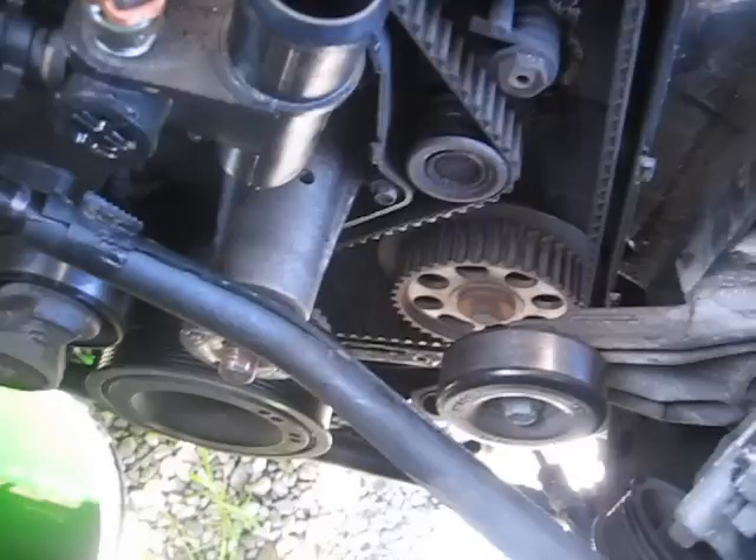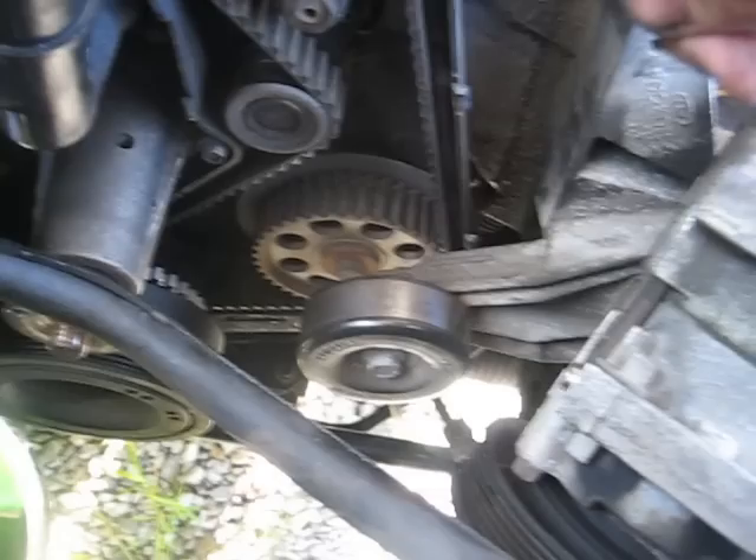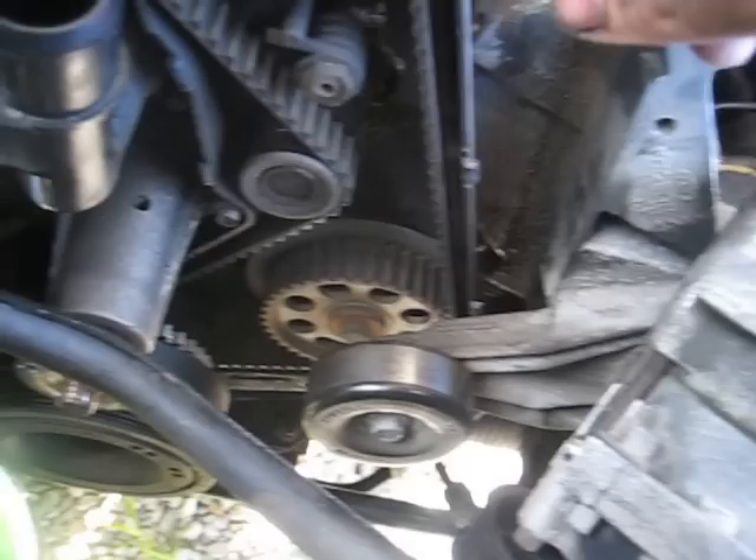On this vehicle it's redesigned from the 89 that I did. On the 89, I had to remove the harmonic balancer because there's a sensor in there - your crankshaft position sensor. This one, they've got the sensor positioned offside over here, so removing the harmonic balancer may not need to be done. There's a 10 millimeter bolt here and another 10 millimeter bolt on the other side of the crank that you're going to have to take out, because that cover has to come off in order for this belt to pass over the harmonic balancer.